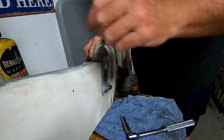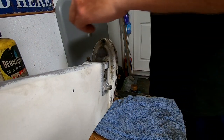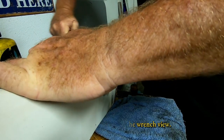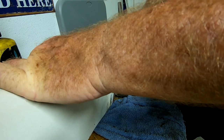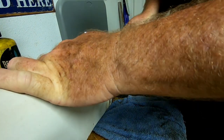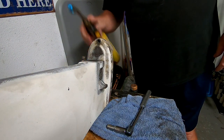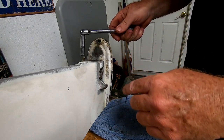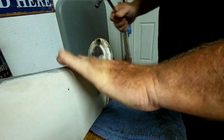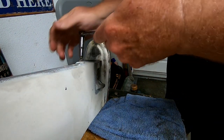It acts like it wants to come but I'll let it soak a second. Use a little breaker bar so I can go back and forth with it. You can see I get a little further each time — and that's when I stop, when I hear that creaking. Now one more heat cycle. I'd like to be able to get at least one side out cleanly. I can feel heat all the way up into here already — it's scary because it's coming really good now. Might have got it hot enough.